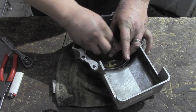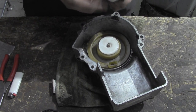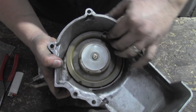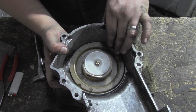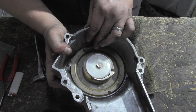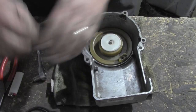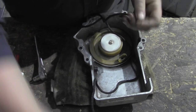The disk goes on there and your little nut goes on — tighten that up good. Now with it all buttoned up, let's test that it works properly. This simulates you pulling on the rope: it pops that dog out, the dog hits the magneto flywheel cup, that spins your motor and wraps you away into bliss.